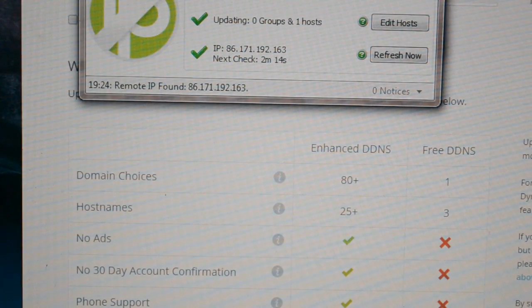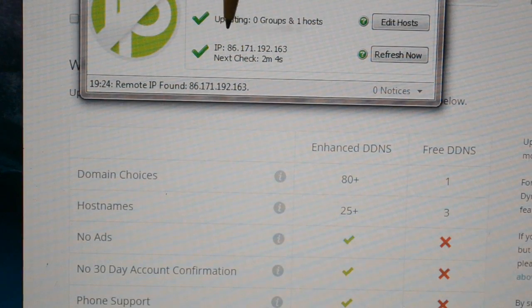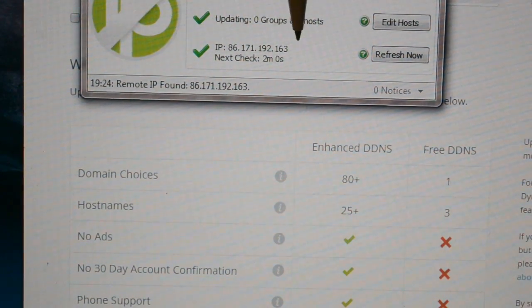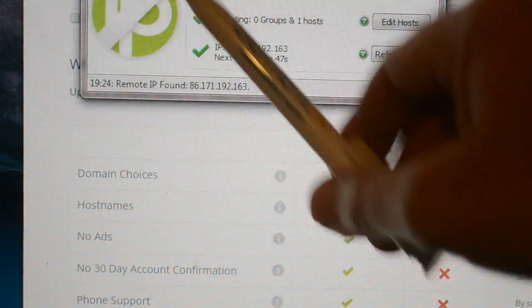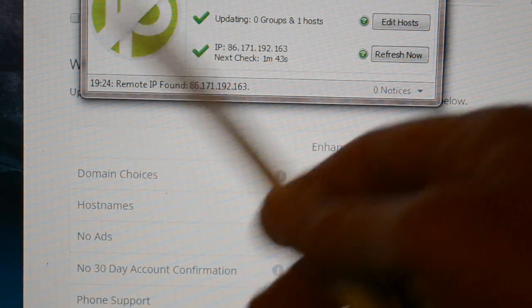If you're on holiday, you might have problems. If you've got terrible broadband from your supplier, then you're going to have trouble. You'd need to access your IP address, and without being on your network from abroad, it's going to be difficult. So have a look at noip.com, just another way. Instead of typing IP addresses, you could just type a name.